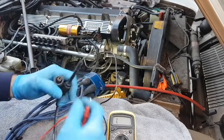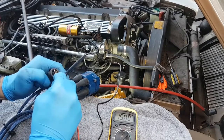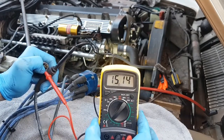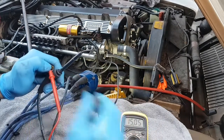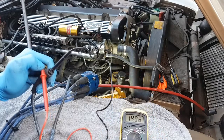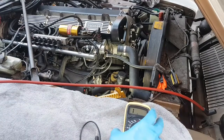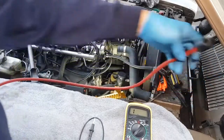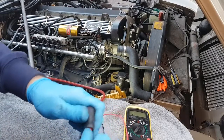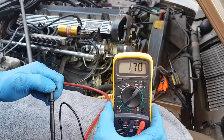It's not making contact - come on, there we go. Gosh, that's high, that's really high. Roughly about 15 ohms give or take. Because I've got my finger on it it's going to distort the reading slightly, but that is enormously high - there's a lot of resistance in those leads. Out of interest, let's get the new red one. I'm expecting this one could be considerably lower - because it's so much thicker the current will flow far easier. These are quite deep, let me just push that in - goodness me, 1.7 ohms!